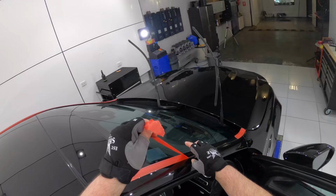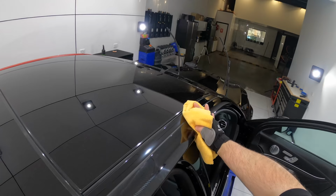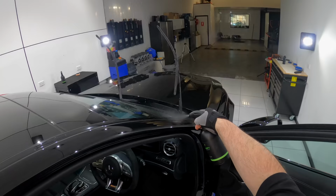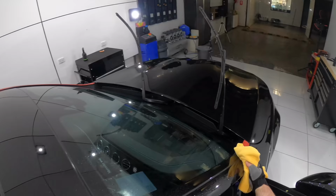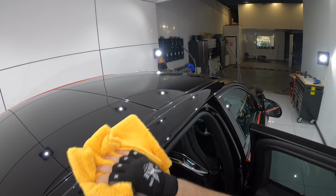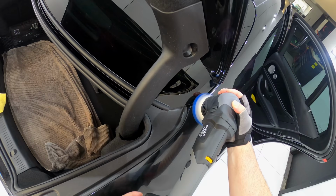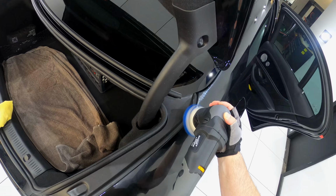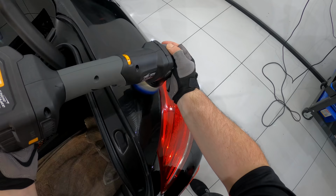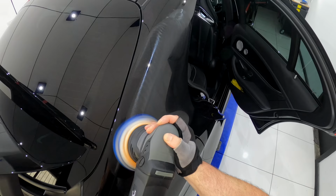But that's not how to respectfully correct car paint and preserve as much clear coat as possible. Using a combination that is more aggressive than it needs to be just because it's bound to remove all the defects is an easy option, but it's certainly not the best option for the longevity of that paint. And performing a two-stage correction when the possibility of a one-stage correction is a viable option is also the easy way out, as it takes a lot more testing and skill to get both fantastic cut and a fantastic finish in a one-step process compared to using a two-step process, which is far easier to get right, but generally more time-consuming and aggressive on the paint by the end.